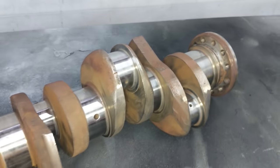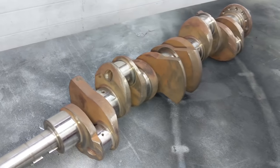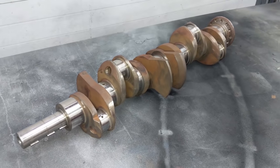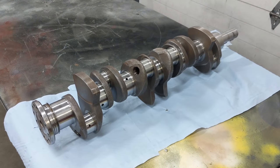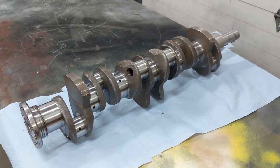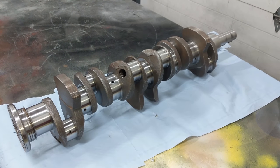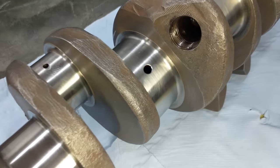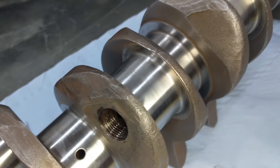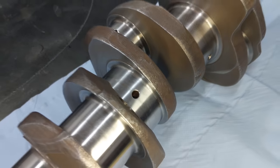It's going to be a simple process to clean this off - all I'm going to use is this Scotch-Brite pad. Really go aggressive on it and then clean it out with some solvent. Here she is - one clean crankshaft. That was really a lot of manual labor on the bench but I'm pretty happy with the result. Really got in there on the bearing surfaces and cleaned out any rust, and they came out looking superb without much effort.